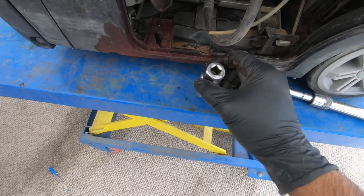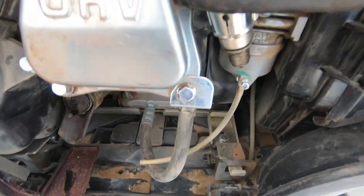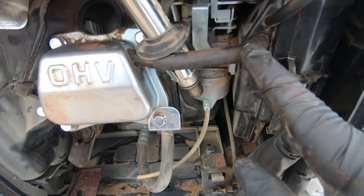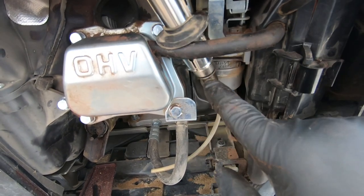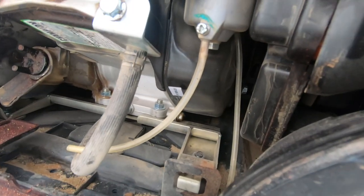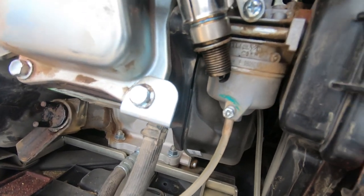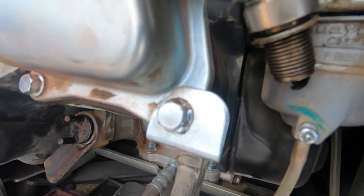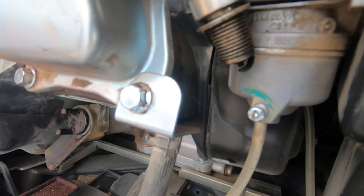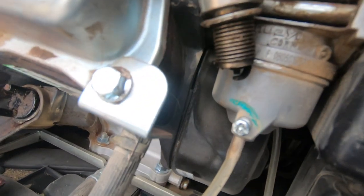After using my spark plug socket I removed the spark plug, and I pulled this little tube here and put the spark plug behind it so it makes contact with metal and put that back. What I'm gonna do now is go on the other side and try to start the engine — we should see spark right here. If we don't have spark, then we found a problem.